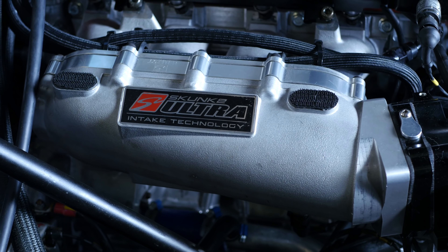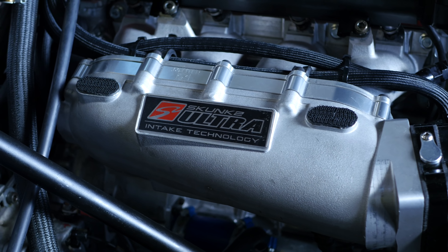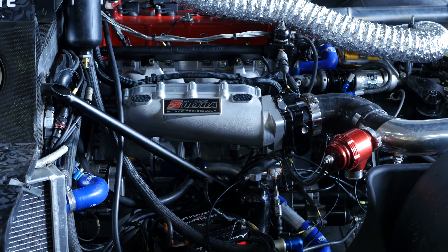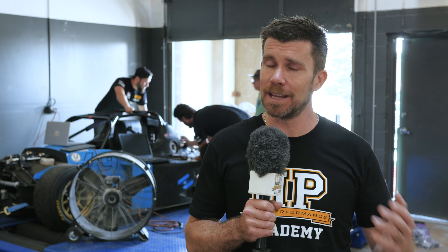Another slightly stranger aspect we are investigating: because this engine has recently been swapped, we're also investigating the intake manifold just to make sure that there hasn't been a rag left inside the intake system somewhere that's ended up reducing the airflow into two of the cylinders. At this point we've covered the simple and basic aspects and haven't found a solution, so now we're going to have to delve in a little bit deeper to find out what's causing the issues.